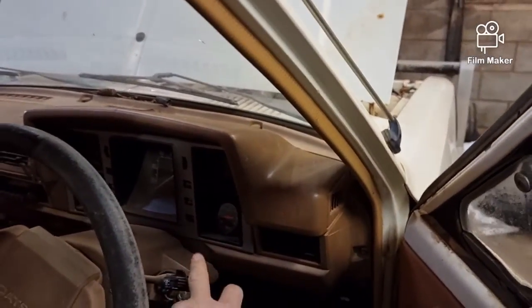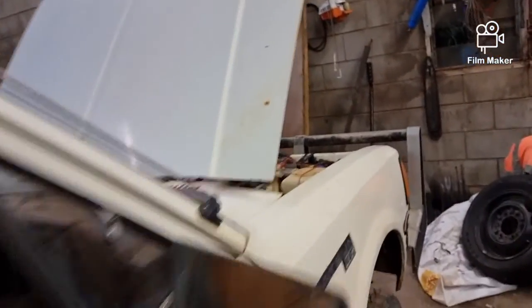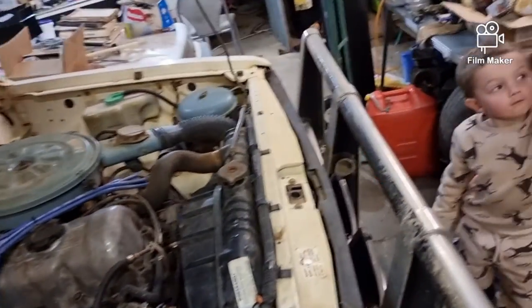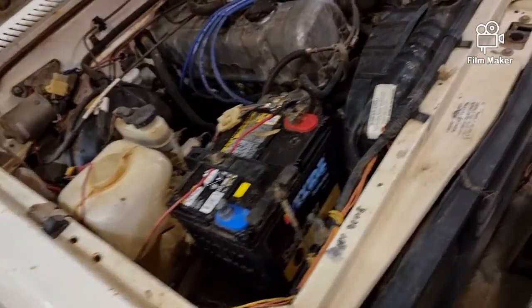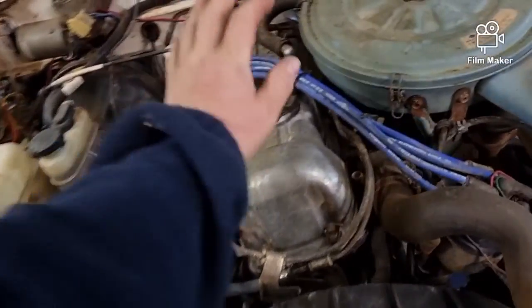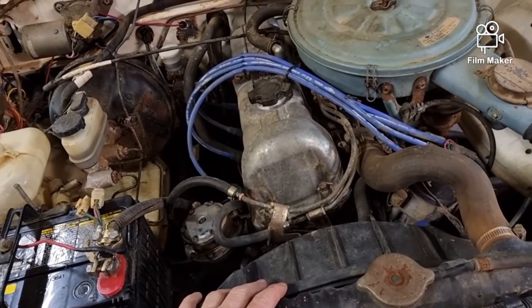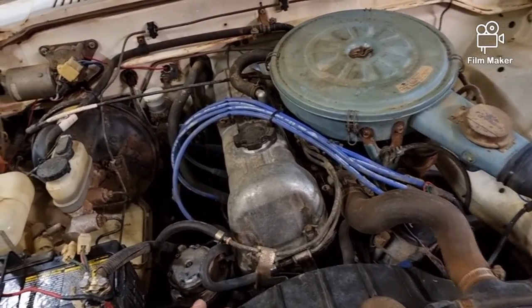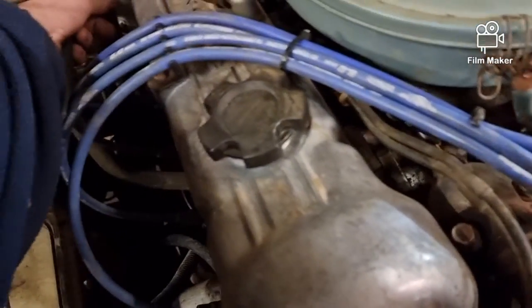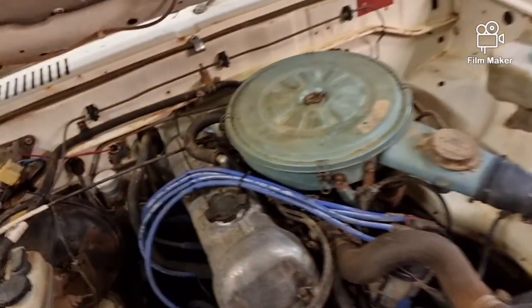This one's wired up like the diesel — turned it off. She's had a run, it's hot but I don't think it's over temperature. I think it needs a thermostat. It's still hot enough I can't hold my hand on there. Unless the heaters are blocked with crap — but it's returning hot water that way, so they're open.